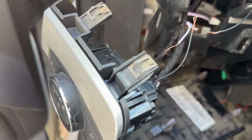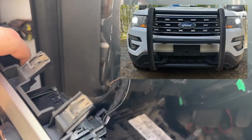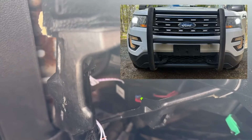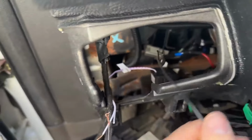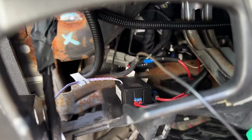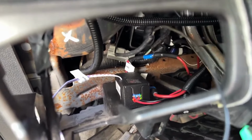That's the conundrum. So we've got it working, but now that our fogs are working, when we turn it on, we can hear and we can see that they're turning off and on, but there's no fog indicator now because this isn't hooked up. And you might think, hey, why can't you just hook this up too? It shorts out our little relay there.